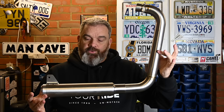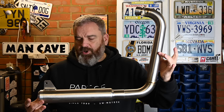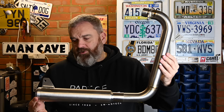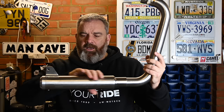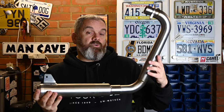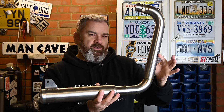This is the exhaust I went for — it is the Short Shot from Sold Out Motorcycles. It's been in development, refined, with some design changes, and this is their first version that's gone into production. It's effectively a straight-through exhaust, but there is a perforated tube and some packing inside to help keep things quiet. They are working on a couple of different variations — one with a removable baffle and another with a honeycomb section, both to help keep things quiet.